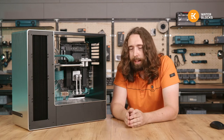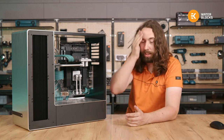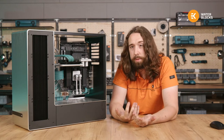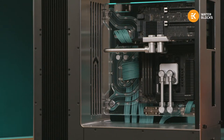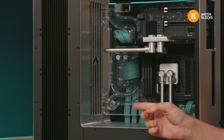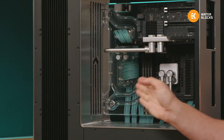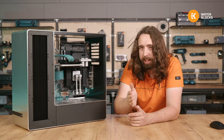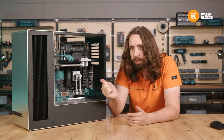They don't really add to the cooling. While it's true they will feel hot more so than acrylic because they conduct the heat through them quite easily, the surface area of the tube, this tiny tube, is completely insignificant relative to a radiator. When you imagine these radiators have a continuous sheet of copper that's folded over and over and over and over again, and like 15 stacks of them, and they're all 60 millimeters deep, and they have a fan blowing directly through them, that's such a colossal area versus the outside of a tube.